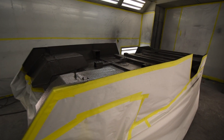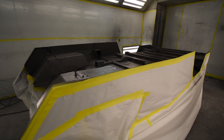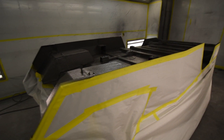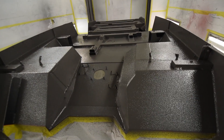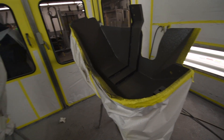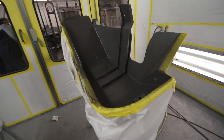Today's a really big day — we're doing the undercoat bed liner to the underside of the aluminum body tub. It's a color match, so it's going to be very similar to the actual color we're painting the whole vehicle. It's all aluminum, and it's a wrinkle coat. We're also doing the front fenders — these are aluminum as well. They've already been painted on the top side and we just left them in a primer on the bottom. Looks excellent.